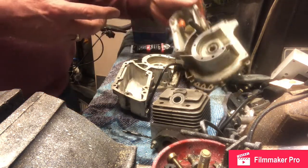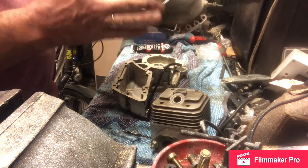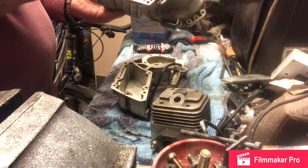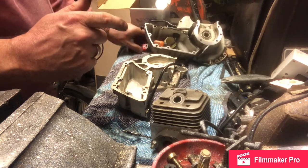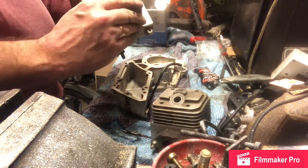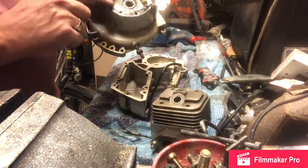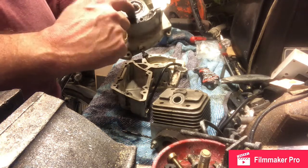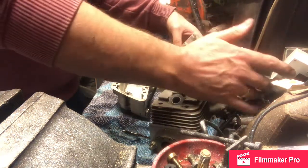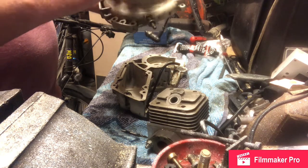We'll do the other half. I can see I've got the fuel filter in there — that's been cleaned. You can actually remove it through there but since I've got such good access it would be a shame not to. Then I'll go get the crankshaft. I've put that in the freezer with the intention of contracting it so it goes through the inner of the bearings easier — a trick I've been meaning to use for a while.